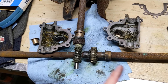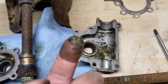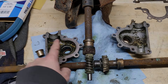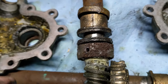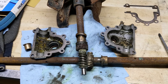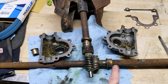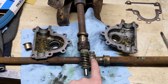Like I said, this could have all been prevented — you can see that this is pretty much bone dry in here, other than a little bit of grease. So what happened? Well the gasket is okay, so the only thing I could think of is that the seals failed. There's a rubber seal right here and you can see it there. You can replace these seals. What would have happened is that over time this unit would have slowly leaked out its lubrication, and then you end up with a situation where it just doesn't have any lubrication and it grinds away at that worm gear.